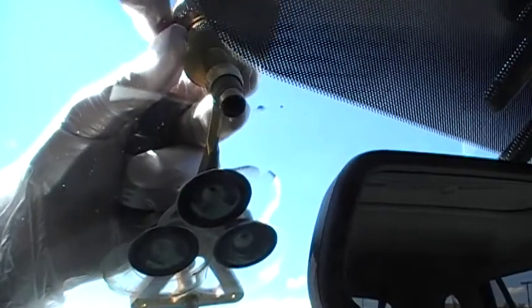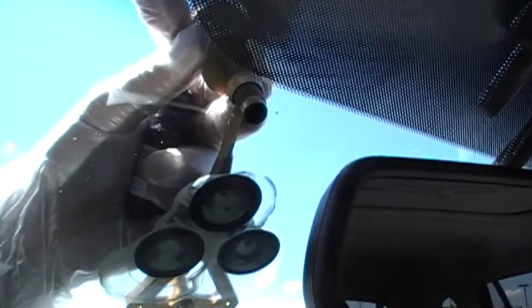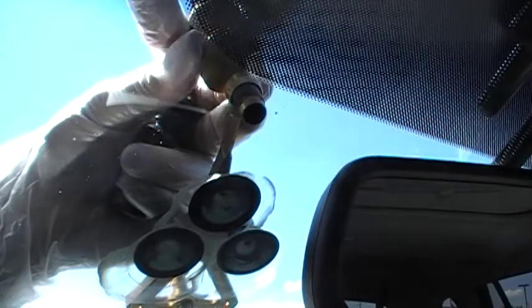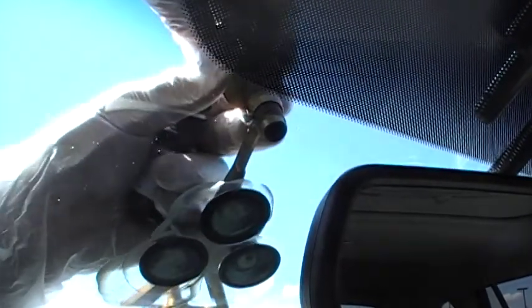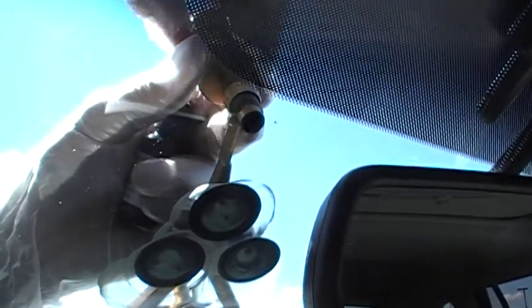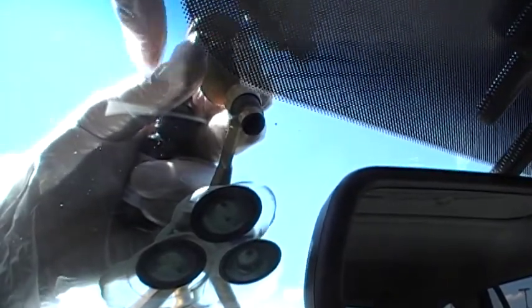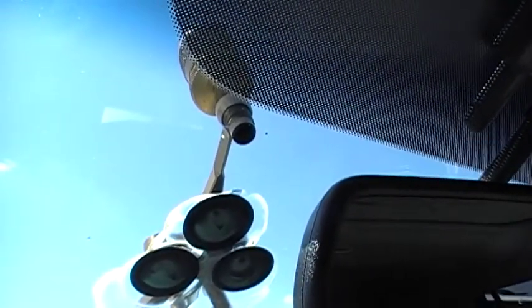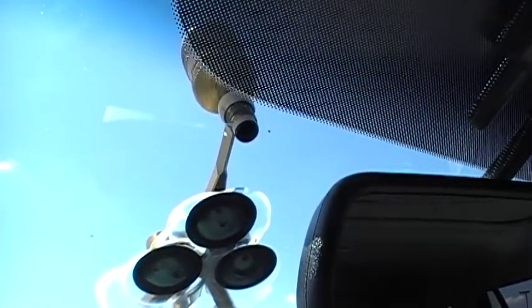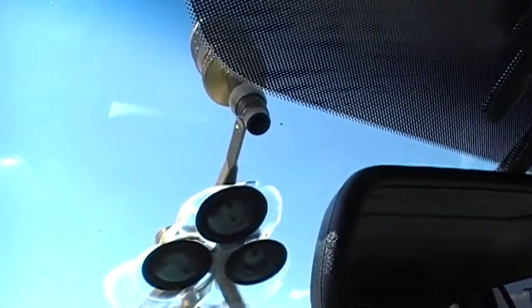You can start to see that fill up. We're going to go in and fill in on top of each of those little tapper spots that we did on each side to prevent the legs from running. Make sure you're doing pressure and vacuum cycles on this — you're primarily going to stay on the main one because that's the main one that needs to get fixed, but we want to make sure we're keeping those legs filled so those don't fail down the road. This tool lets you move back and forth quite easily and fill those other little spots much easier than other companies out there.